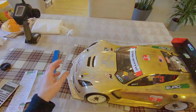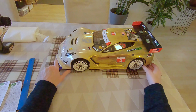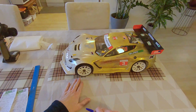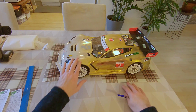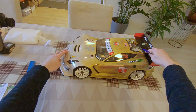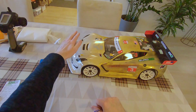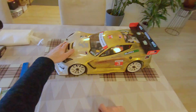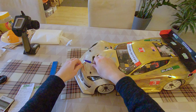So then take off this body. Now you maybe see that the car is a bit high now, because I'm not sure how it is to drive on the go-kart track where we are going to drive. So it has about 2 centimeter or 20 millimeter ground clearance both in the front and the rear. So I could lower it at least a centimeter more if that is possible to run there, and that will make the car run better. But I will just start with this now, so I'm sure I can drive it on this go-kart track. So let's take off this body.